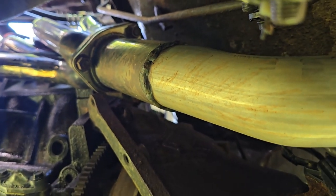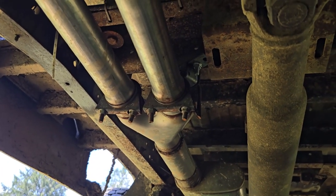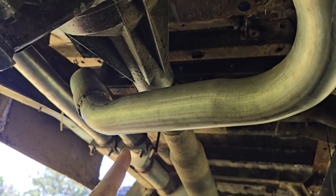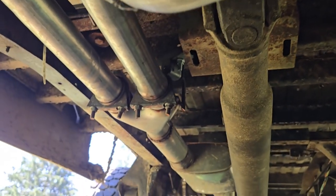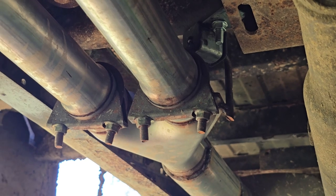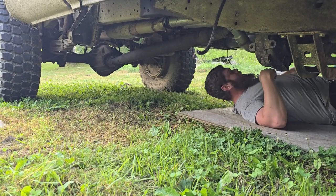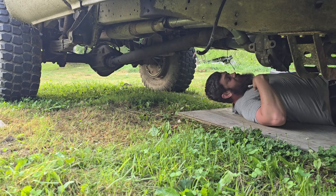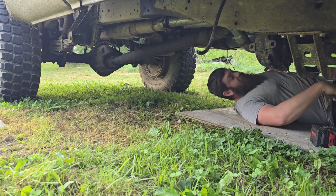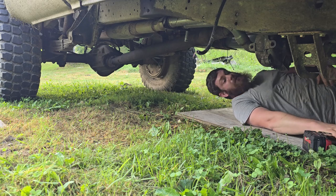You all know about my duct tape fix up there — that'll be fixed eventually. The first step will be removing my exhaust, so I got three bolts up there and my exhaust clamps down below. I'm gonna go ahead and spray this off with a little bit of water to get it cooled down because I just shut this thing off. It's the next day because the thing was too hot to work on last night, and then a buddy of mine wanted to get Chinese. I did PB Blaster these even though they're pretty new.